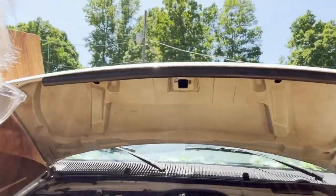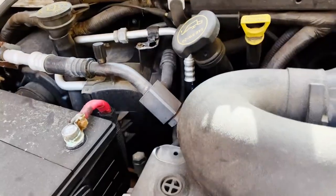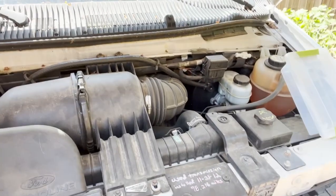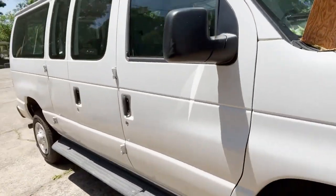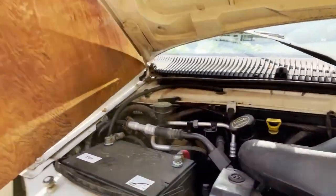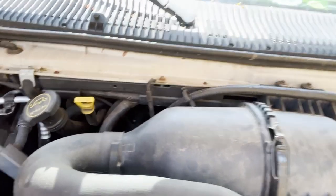In this video I'll be doing an air conditioning compressor and accumulator receiver dryer change, and I'm going to flush the system. The compressor did lock up. First steps will be to get the air box out of here and the serpentine belt. This is a Ford E350 van — that plywood is there just for blocking the light so I wouldn't be shooting into the sun. As big as this is, that compressor is sandwiched in between the cross member and the engine.